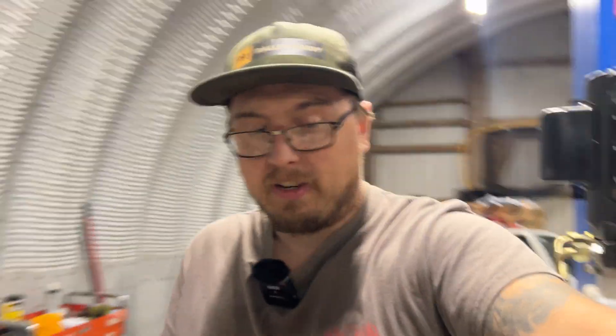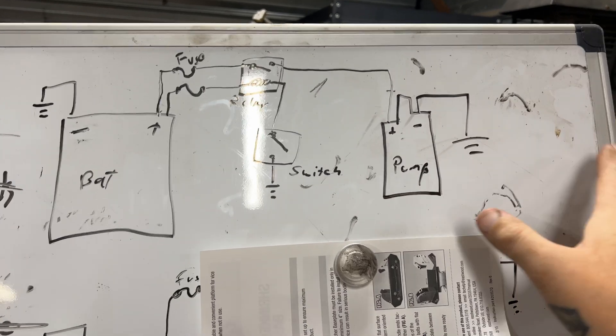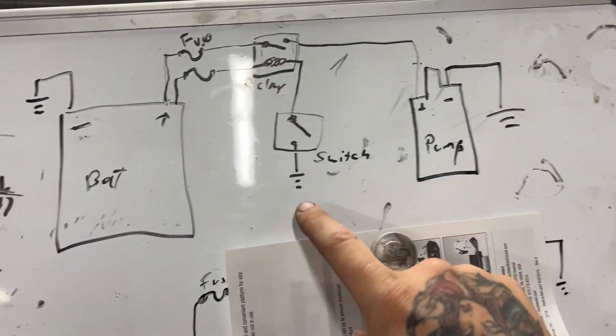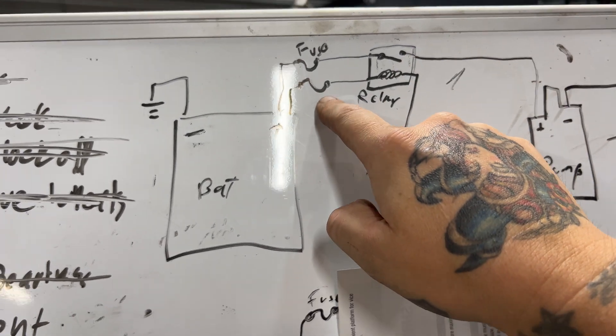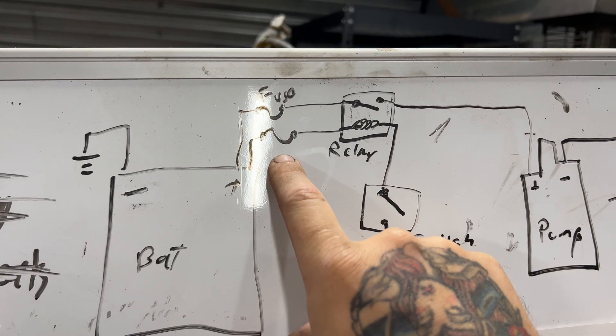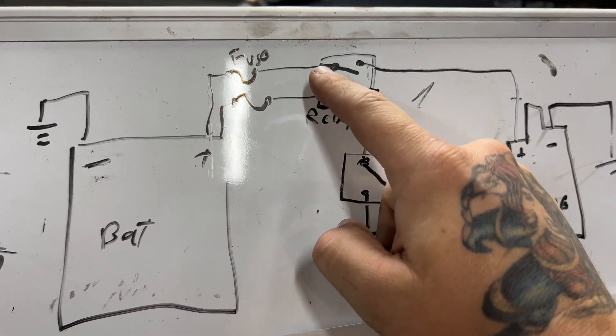The first thing I wanna do is just run over what's normally in a car. So this is a very crude wiring diagram — I'm gonna call this a pump. Could be a water pump, electric water pump, fuel pump — it's all basically the same. We have our battery, we have a relay, we have a switch, and we have two fuses and the pump. These are grounds. So power comes out, you have to have two powers on your relay: one to energize it and one for the switch. You have the relay's fuse and you have the fuel pump's fuse. Power comes in, this gets energized when this switch trips to ground, which completes the circuit for the fuel pump. That is how most basic systems work. Replace the pump with, say, a headlight — there'd be two headlights there on the same circuit and the headlight switch would turn it on.